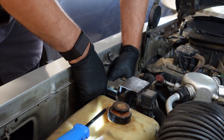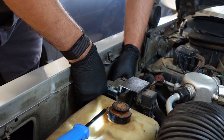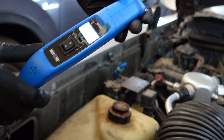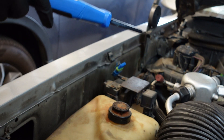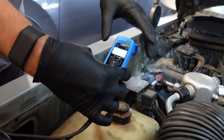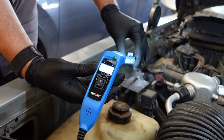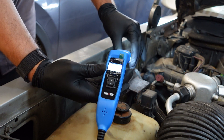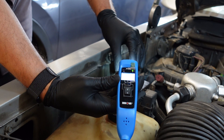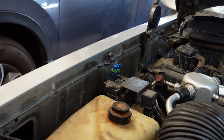Here's our wiring situation. Now I'll demonstrate the swivel feature — right now with it straight you can't see the screen, but if I turn it like this you're able to see the voltages it's reading. To test what's coming through these wires, you just take the tip, don't press anything, and touch the wires. We got zero volts, zero volts, and zero volts. That's exactly what we want to see with the car off. Now let me go turn on the switch and see what happens.